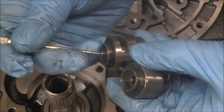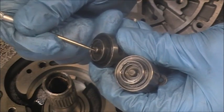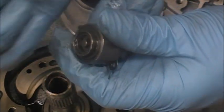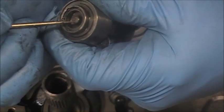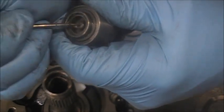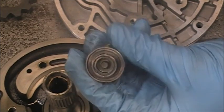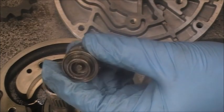This one should be able to spring like that. This one doesn't spring — it's already at the bottom. It's staying stuck down. When it's stuck down, you won't move. I don't know what would happen if it's stuck up, but I do know what would happen if it's stuck down. The bore that this valve moves up and down in starts to wear; the sides of it start to wear and it sticks.